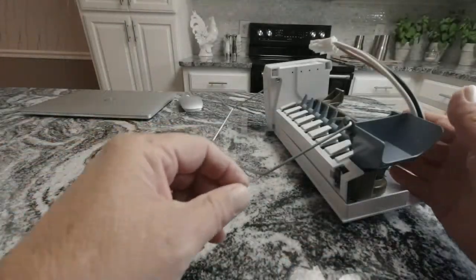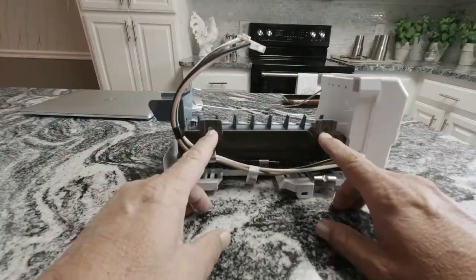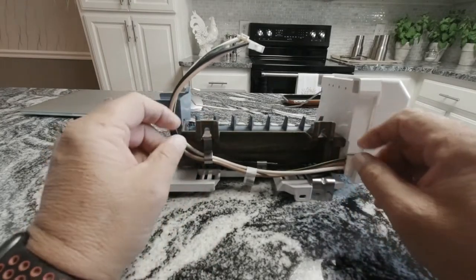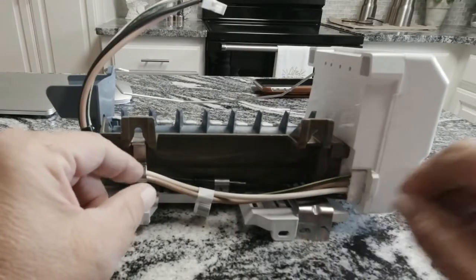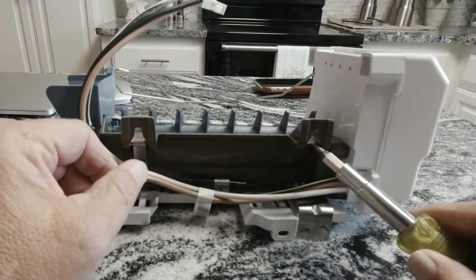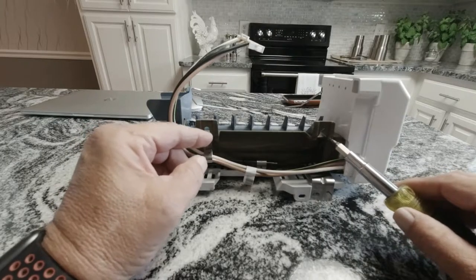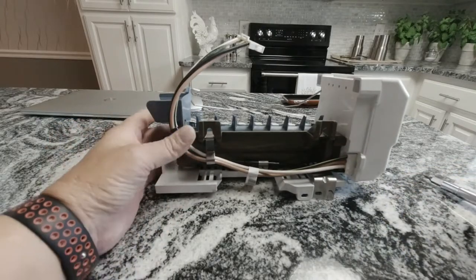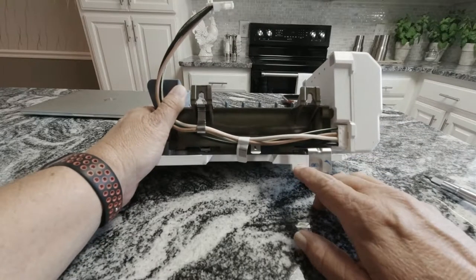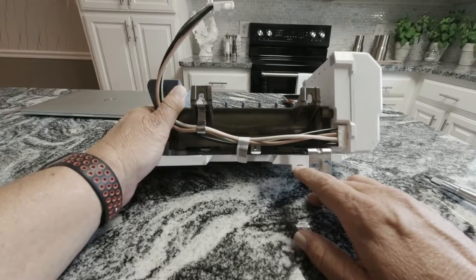As you can see here, this is our ice maker. The two screws holding it on the side wall are here, and you can see they're slotted so that you can, in theory, leave those screws in place and just pull the ice maker up. However, it does have a third mounting screw here that mounts permanently, so that one is why it has to come out completely.